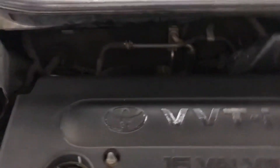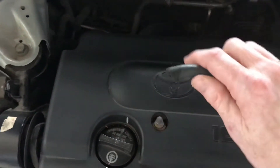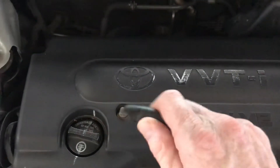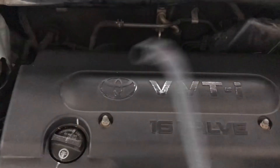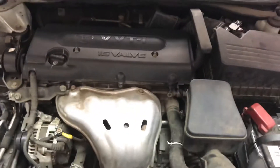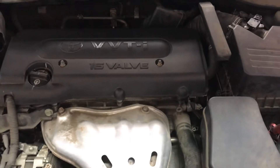It's a four-dollar part, so I just took it off. When I was taking it off, unfortunately the hose you see right here snapped because it was brittle — it just sort of snapped off right there. I thought, 'Oh good, either the PCV valve was bad or this hose had a vacuum leak.' After replacing that and the hose, I cleared the code with my reader and drove about 50 miles over multiple days and cycles. The check engine light did come back on.